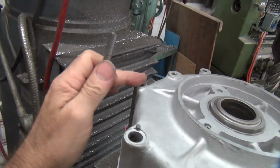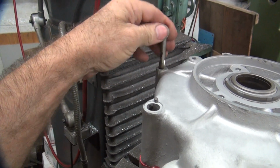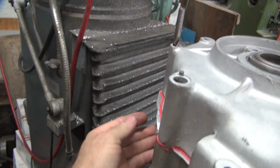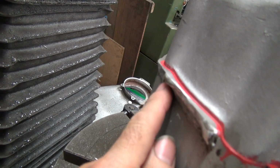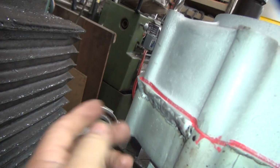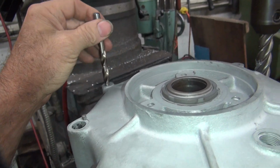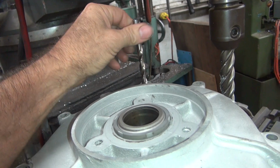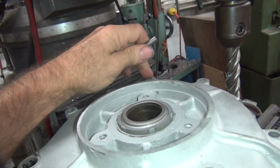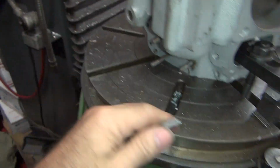So these are the dowel studs, this one and this one here. So you line that up and you punch it through. You should only have to go through about a 1/2 inch max here because that's where only the weld is at. I should punch through. I can run my reamer through after that. These are a little tight because the holes are compressed from the bolts. Okay, now this feels like I'm still lined up on this side and these here.